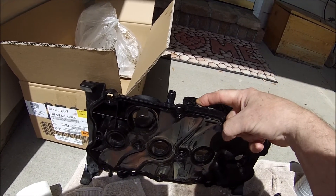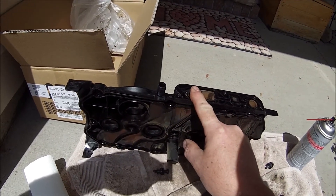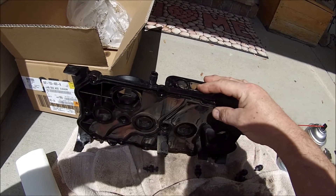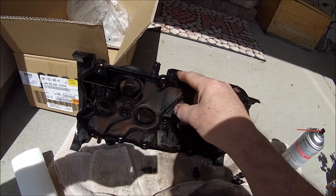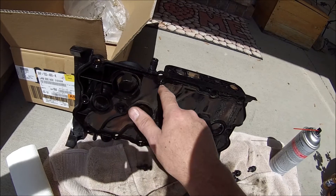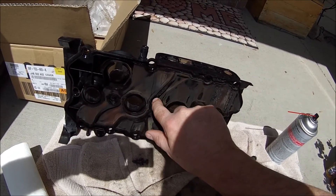I also checked the rear breather tube and the first port going left to right for the PCV, and that appeared to be okay. Where I found the problem was the port that crosses over, which is the second one — inside the PCV or the block-off plate. Even though there was good pressure in this route, I noticed when I sprayed some cleaner that it was trickling out right along this edge right here.